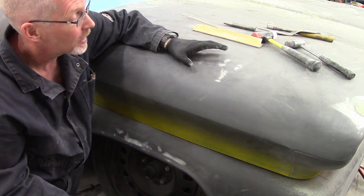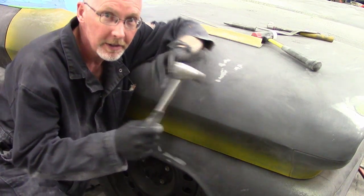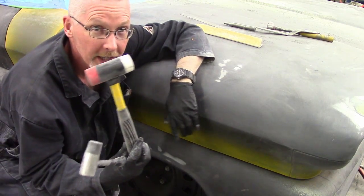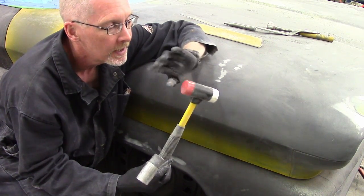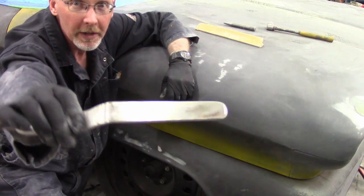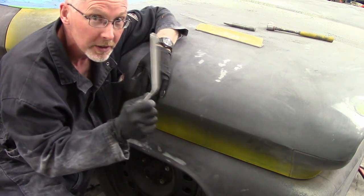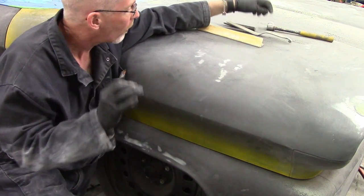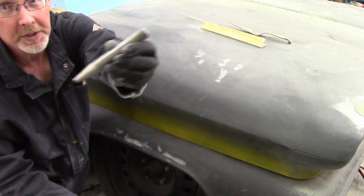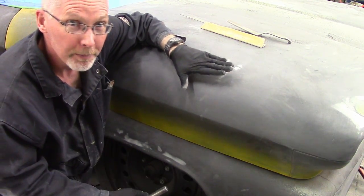You can get rid of the high spots a couple ways. Or you could just put down so much paint and then keep sanding it to fill all of the low spots with primer. This was my old smacker, but the end broke, so I bought another one which I don't like as much — it's not as heavy, but it's probably gentler because it's a bigger tip. It came with brass and aluminum ends which I'm not likely going to use — I want plastic. Also made out of a file, ground all nice and smooth. This is just a slapper — you can get in there and slap this and try to work it down really kind of gently. This is a really good way to go. It takes a while. If there are point issues, you could use a body hammer.